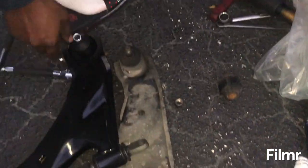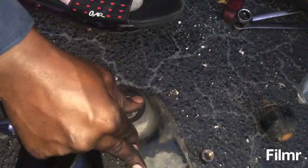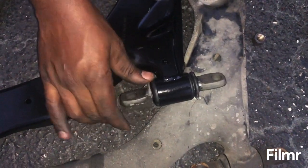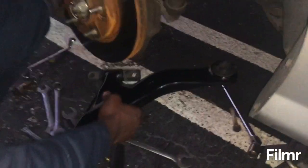Give me the other control arm. New one. Always remember to remove the screw. Take out this plastic. Look, it's firm. Look at this. Easy. You hear that? Listen. It's firm. It's okay. It's okay too. So always remember to put it on like this, to prevent the ball joint from shifting. Bushing. So always remember to put it on like this. Just like this. Easy how it goes.